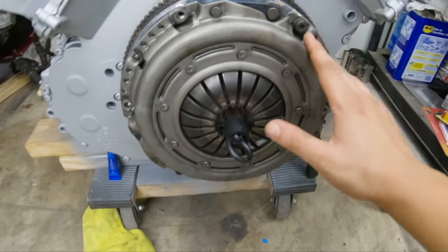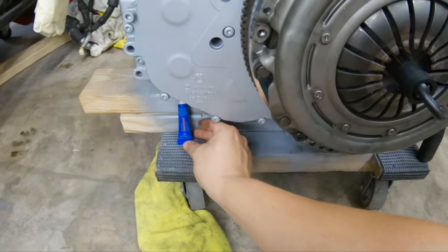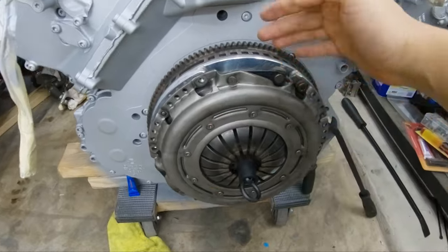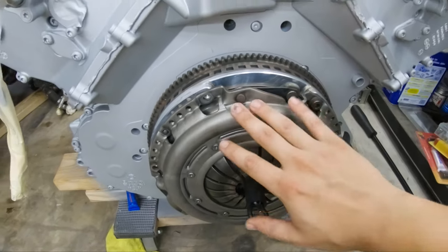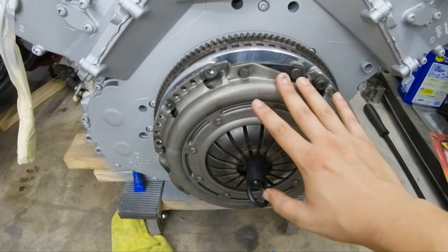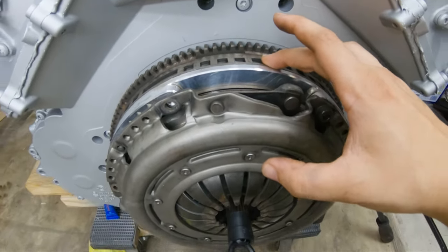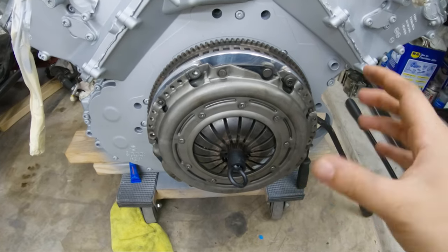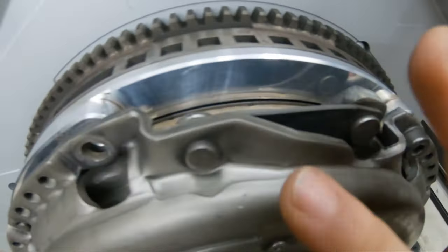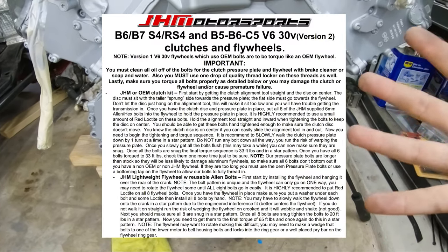Now that the pressure plate is on, I used two screws just temporarily to hold the clutch in place for extra security beyond the dowels. These six bolts will use a high-strength thread locker. Even though I'm using two different brands — 034/JHM for the flywheel and Ringer Racing for the clutch/pressure plate — I'm still using JHM's torque specs for the pressure plate because the threads are going into the JHM flywheel, and the material should be essentially the same.